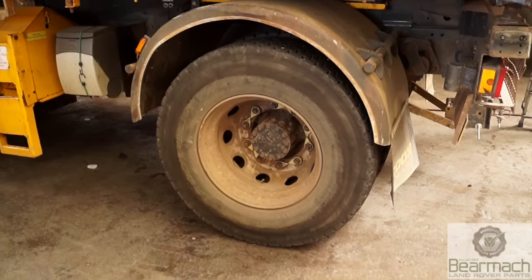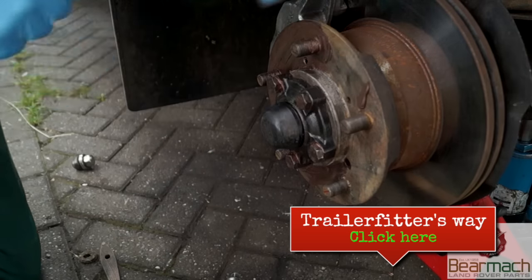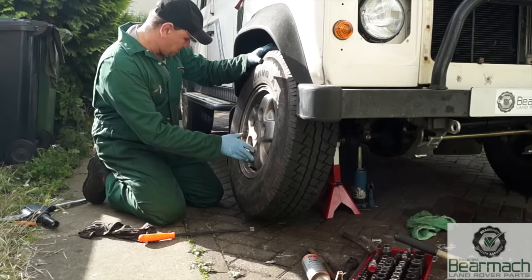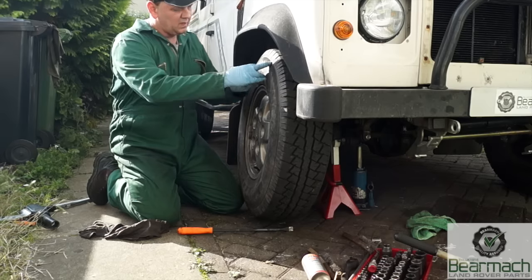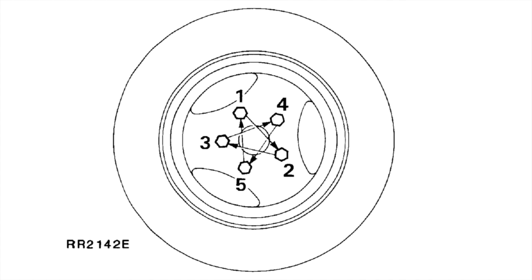So we'll stick with the Land Rover way of doing this on this tutorial. There is a video on an alternative way, however if you don't feel confident use the method Land Rover recommends in the workshop manual and check that for your own specific vehicle. We have copper slip on the spigot face and we're going to mount the wheel once again. There is a tightening sequence for the wheel to follow — Land Rover recommend first putting the nuts on and winding at least three threads before using this sequence, which is like a pentagram star, tightening the opposite nut to the one done previously.